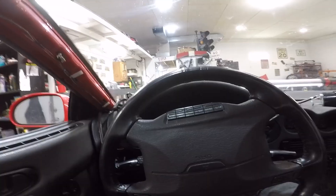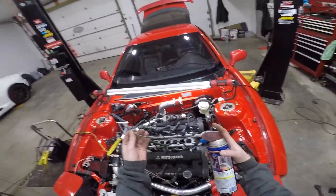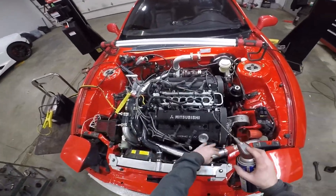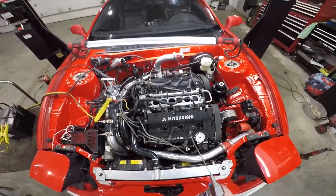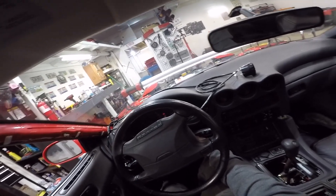Oil pressure is going up. About half a tank of good fuel. I'm debating whether I should spray some WD-40 down in the cylinders. I'm putting some WD down in there — I got the metal straw and I just bend it so I can get down in the spark plug hole, spray it up at the top and it'll roll down. Going to finish priming just to lube those walls a little bit — just a tiny baby squirt. Oil pressure jumps right up. I'm pretty good to start this thing.